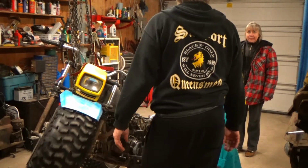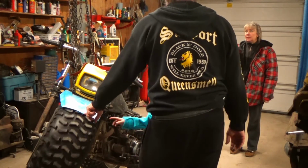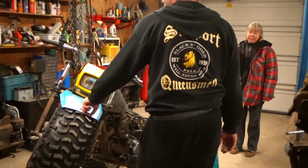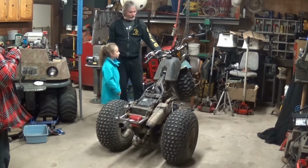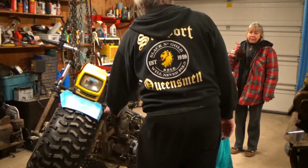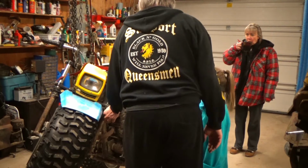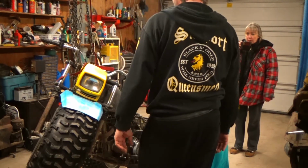So you know what I've discovered? Like I sort of woke up in the middle of the night screaming about? Other than me being a ditz? Right. Other than that, the reason this fender is so low to the tire is I think these shocks are compressed and stuck in the up position. I think that's why the rubber boots are all squeezed together.